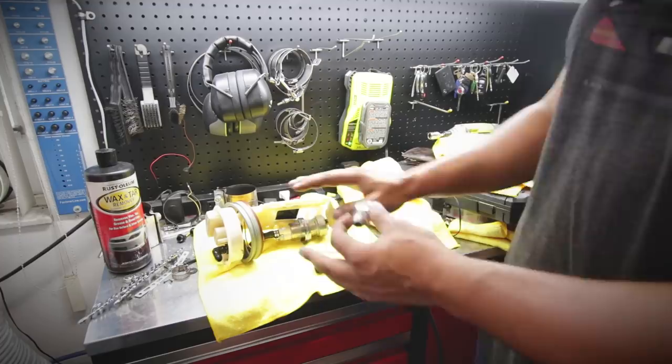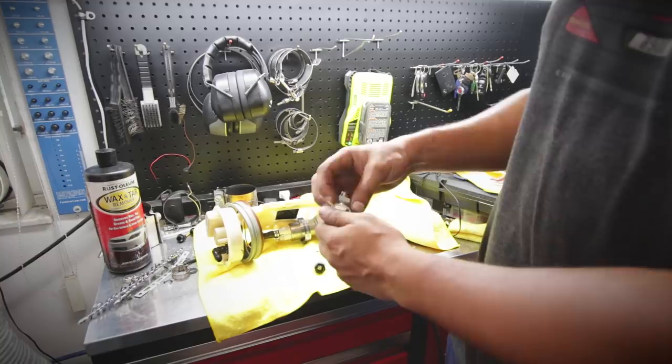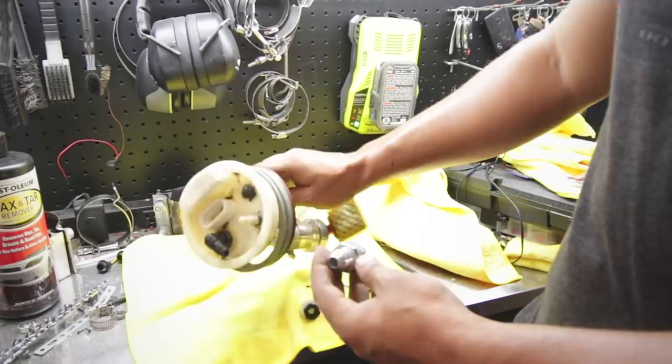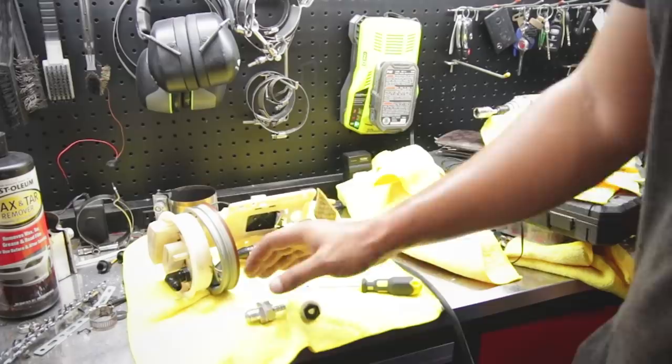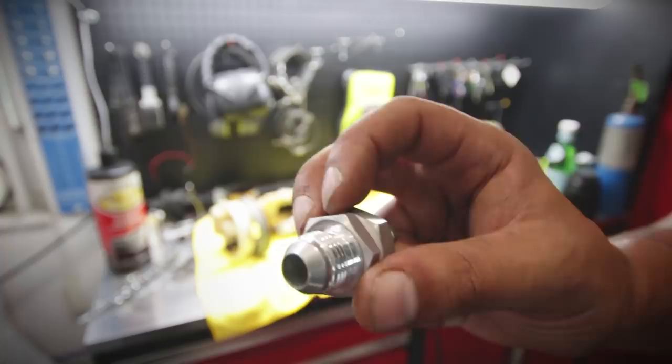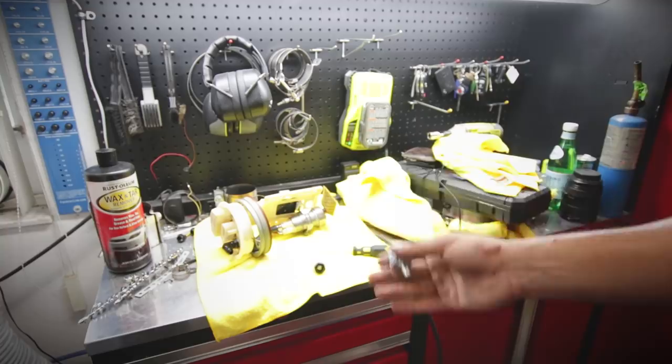Before doing modifications, make sure to put some thread sealant or blue Loctite on the threads because you don't want these fittings coming off inside the fuel tank. We're going to make sure everything is tight and put it on the car. We'll also have to make a whole new fuel line because this 8 AN fitting is not in the right position for the existing fuel line. I'm not sure we'll get to the interior rebuild today, but this is more important — I don't want the car bursting into flames.